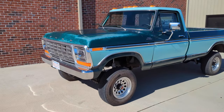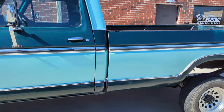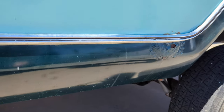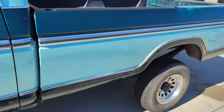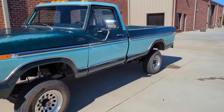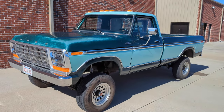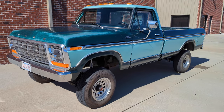Cosmetically, the truck is pretty good. It doesn't appear to have any major accidents, but we've got to deal with some metal work issues. There's some rust — you can zoom in down here and see a spot. You can kind of see in the video the cancer coming through on the lower bed. And if you crawl up underneath it, you can see where there's been some patching done on the bed floor. As I mentioned, the floor pans were patched and not done very well. So we're definitely going to have some work to do on the sheet metal. We're going to keep everything else pretty much the same — keep the trim, keep the lights on top of the cab, and just the basic look of the thing — but fix all the rust, repaint everything, and make it pretty again.